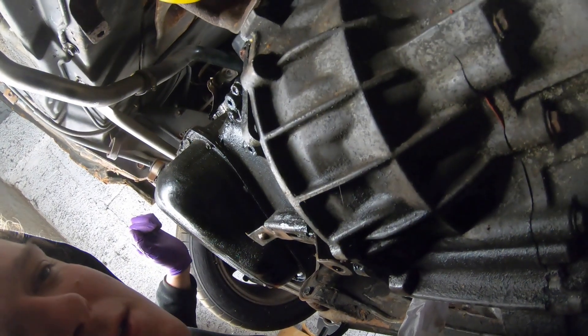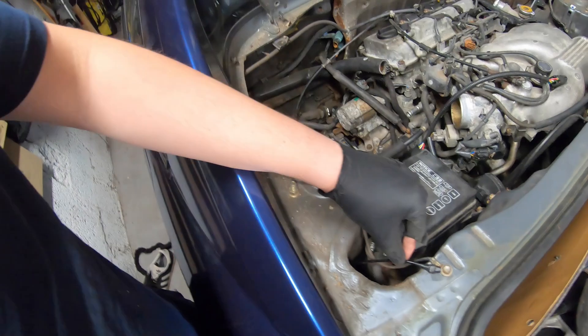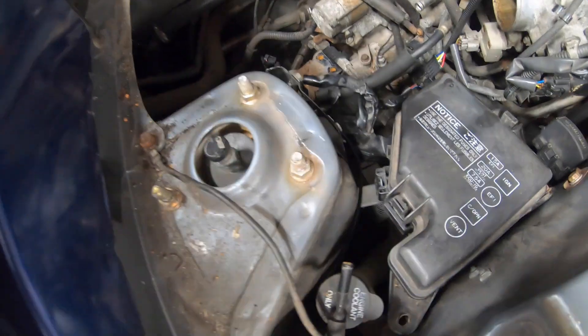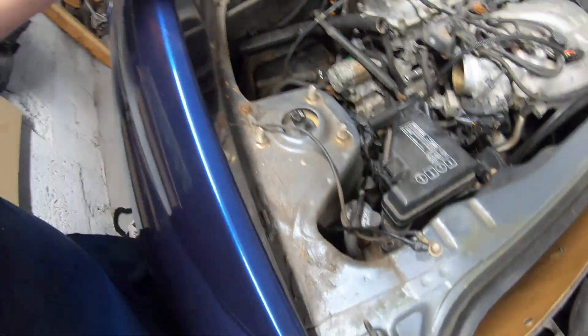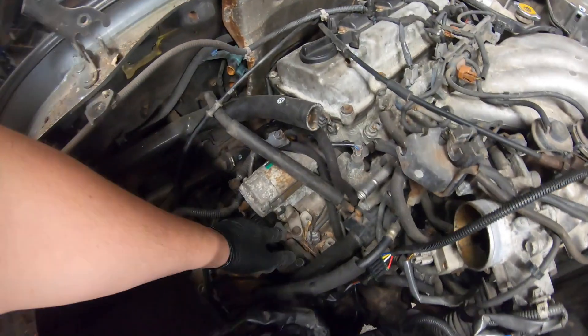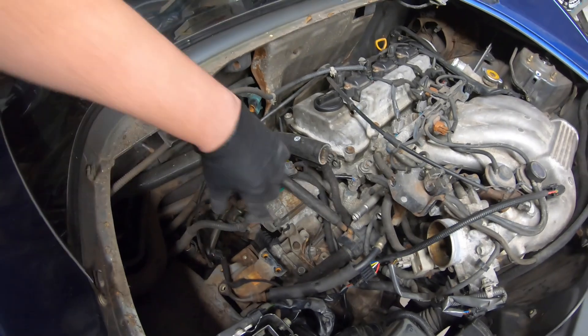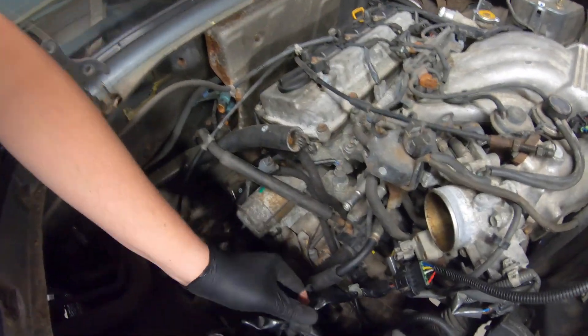Next thing - I can't quite remember how the clutch assembly goes, but I can see where the lever is. To show what I've been doing on the earth connections: there's an extra earth here connecting onto a bolt that was all cleaned up - earth to the body - plus an additional earth to the body, as per Paul's recommendations. I've connected those on and there's a bracket bolt secured there too.